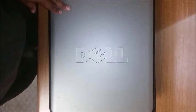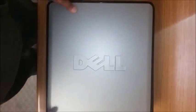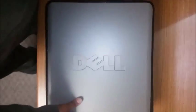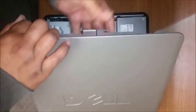Today we are changing out a bad hard drive, or replacing or upgrading a hard drive for a Dell 380 low pro. This is a common practice — sometimes you want to go to a bigger drive, or you have bad sectors in your old drive. Take off the lid: proceed to push the lever backwards to help release the lid up.